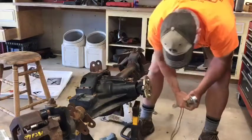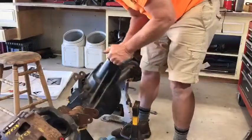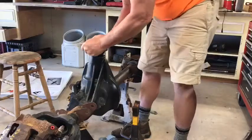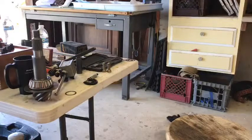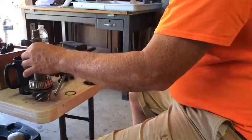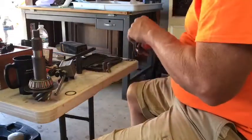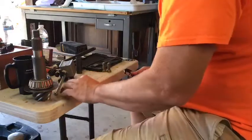Now let's flip my differential back up — boy, that is tight. I want to make a little video to help you understand just how much fun it is to get this preload right. I've got this stack of shims and I've been adding shims and taking shims off, using a little measurement gauge here to see how many thousandths I'm taking off or removing.